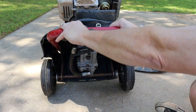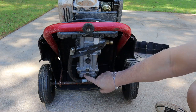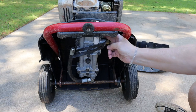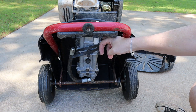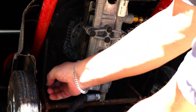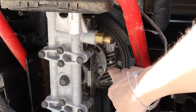Here's how the factory pump looks. It's got a surge hose, which is where a lot of leaks come from. And then also up here at the caps where the pistons are, they also tend to leak after a while. That's what's going on with mine — I've got a surge hose on there that works fine, but I've started to get some leaking from behind this piece, the caps over the pistons. The next thing to do is to get this pump out. Now the factory pump has four bolts right here on the bottom of the engine, which are different than the engine mounting bolts. There's a pump mounting bolt here, here, here, and here.